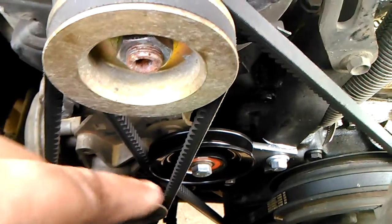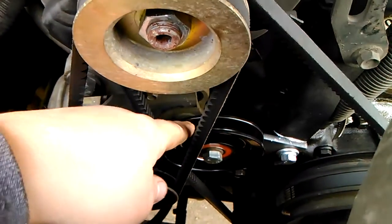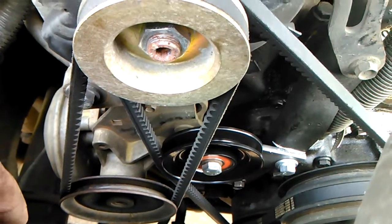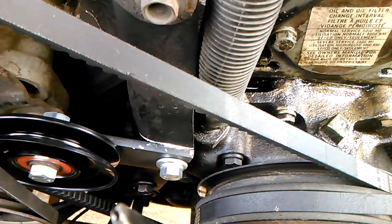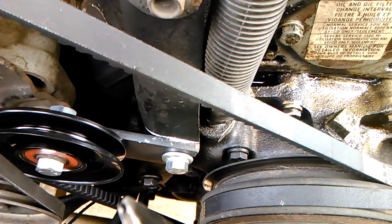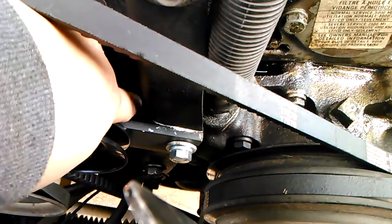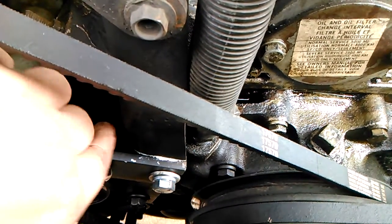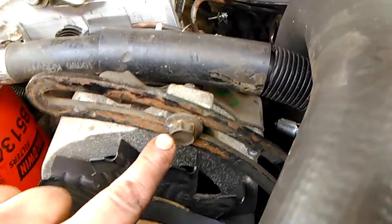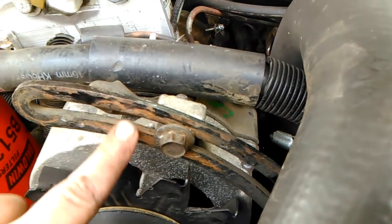The bushing inside that pulley is a little larger than I like, but when it's all tight, this pulley isn't moving up and down. Hopefully with some pressure on it, it's not going to travel too much. I did mark it with whiteout so I can see if this bracket moves up. If it does, I'm either going to weld or bolt an adjustable stop on the back of it here next to this bracket so it'll stop against it. I'd want it adjustable because this belt's going to stretch over time — it'll stretch all the way out to there.